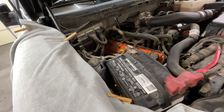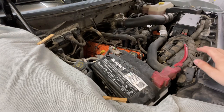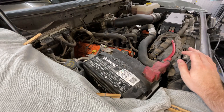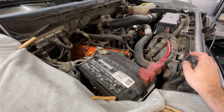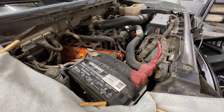I know that was the upper radiator hose — I know the original owner of this truck, and he had it pop on him at some point. It doesn't have OEM clamps on it. All of those parts are going to get replaced with all OEM stuff. To my knowledge it wasn't overheated, at least not severely, so there shouldn't be any engine issues. But at 155,000 miles, everything's getting replaced. I live in Arizona where everything dry rots, so it's not a good situation for rubbers and plastics.